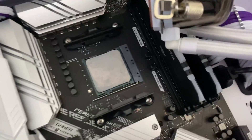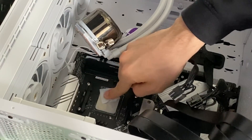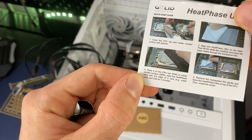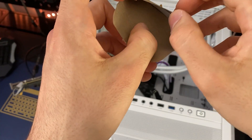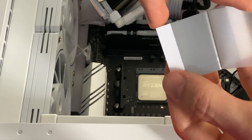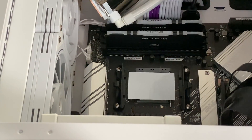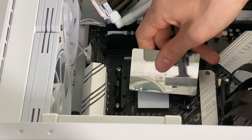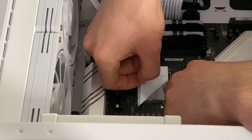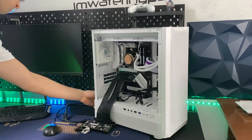After taking the full baseline, we went ahead and installed the Heat Phase. The cooler I'm using is a 360mm all-in-one water cooler, but this thing will work for air coolers and water coolers alike. We cleaned up the paste and moved forward to applying the Heat Phase Ultra. You're supposed to apply it on the CPU cooler block — it comes with an instruction manual so it's hard to do it wrong — but I decided to install it on the CPU instead. You have to spread it evenly using a card. We got it installed, evenly spread, closed everything up, and proceeded with testing.